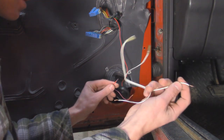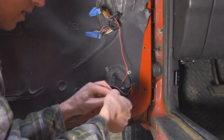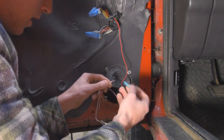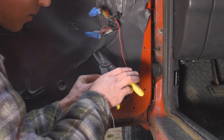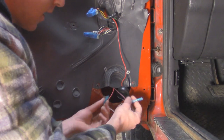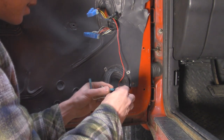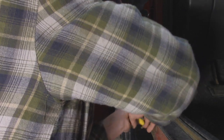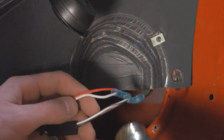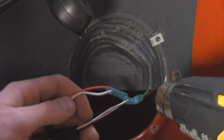For this speaker the white wire is positive, and for the tweeter the red one is going to be positive. I'm just going to twist these together and use some butt connectors — these are thin enough to fit the blue size. Before I crimp these to the harness coming out of the Jeep, I'm going to slide over some heat shrink connectors so everything is nice and watertight. Since these butt connectors do heat shrink I'm going to do that and then slide the heat shrink over that as well, so it's double protected.